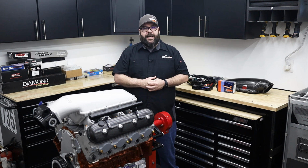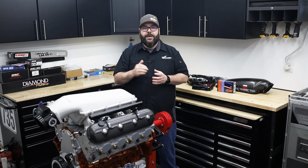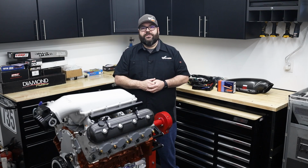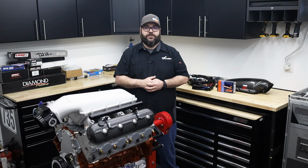After speaking with their tech, they confirmed that our gut instinct to just order a size up on the injectors was the right call. Having too big of an injector is a mostly non-issue these days. And as they pointed out, with our RPM goals, having a bigger injector would be beneficial when it comes to the incredibly small pulse widths we'll be seeing.